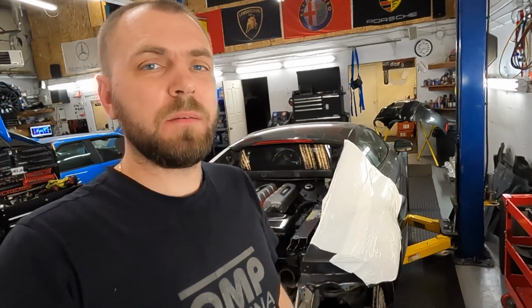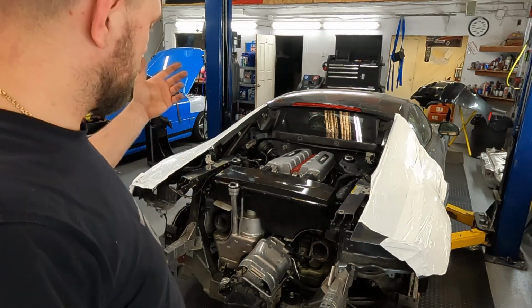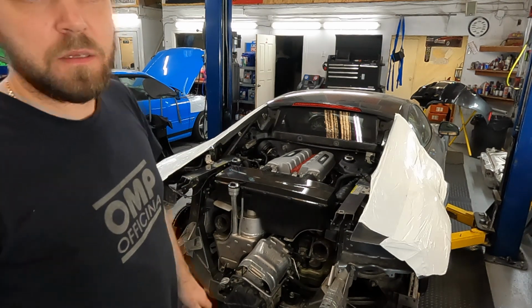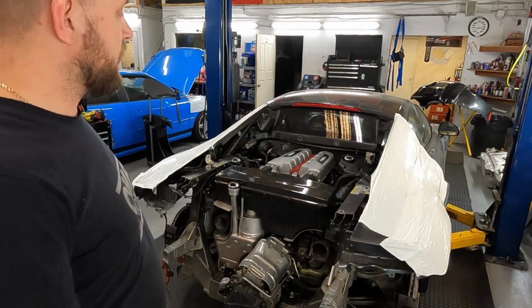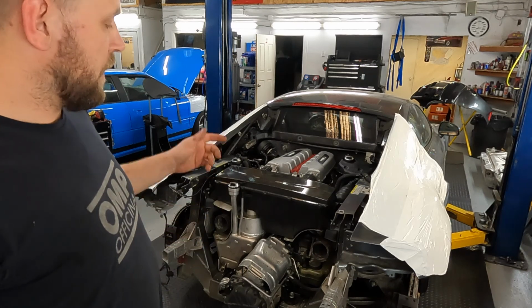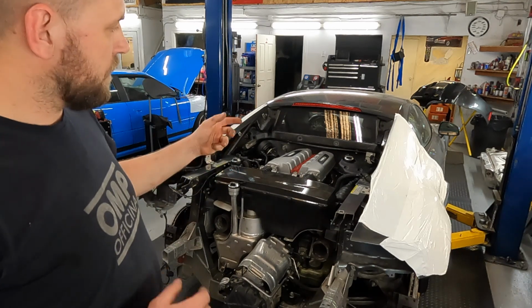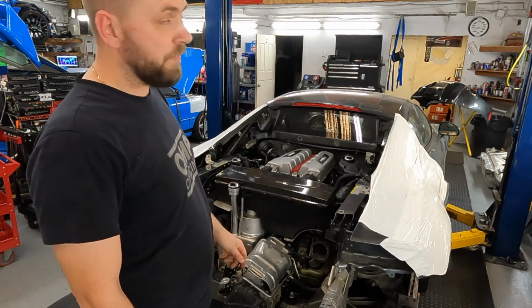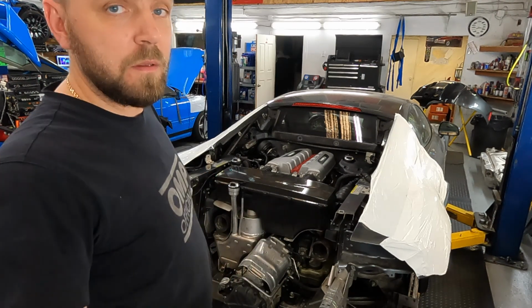Well, almost everything is assembled back. Transmission, clutch, all wiring, new spark plugs, and I just connect the power and fill the engine oil. Let's fire up, check quickly what's going on, and then I have to start bleeding the clutch system and other things like checking the coolant line and AC refrigerant. But first, without everything, I want to make sure the engine is working fine. Let's try to fire up.